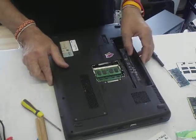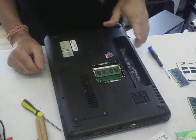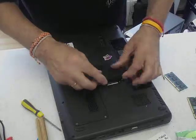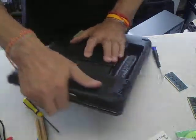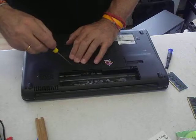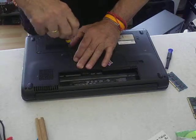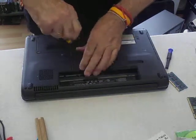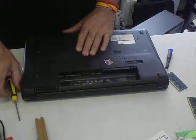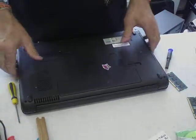The first thing you do after replacing RAM is put the battery back in and fire it up to make sure the system has seen the new RAM. You can check this under Control Panel > System > Device Manager, under General, which shows the processor speed, operating system, and how much RAM you have. For example, if it shows 768MB, that means you have 1GB fitted but 256MB of it is being used to supply the graphics card. That's the laptop section done.